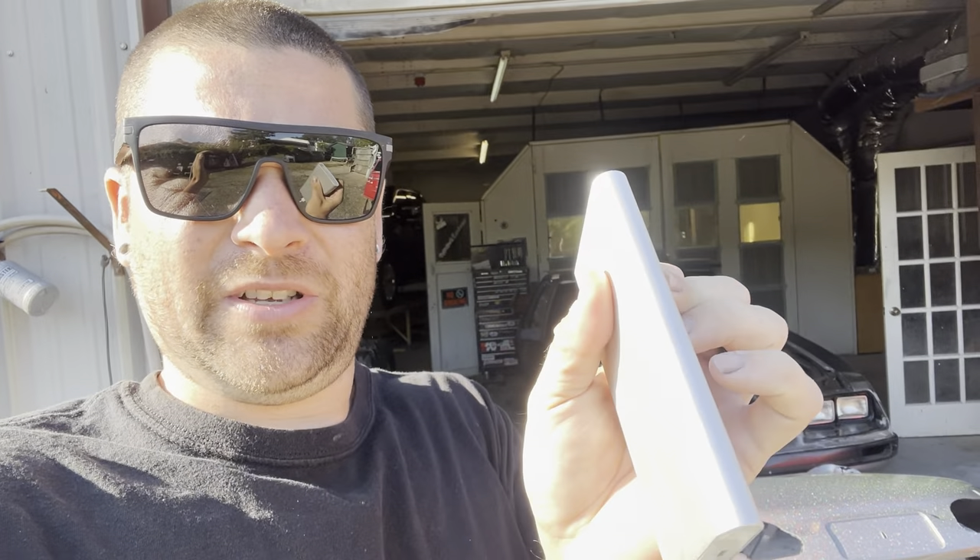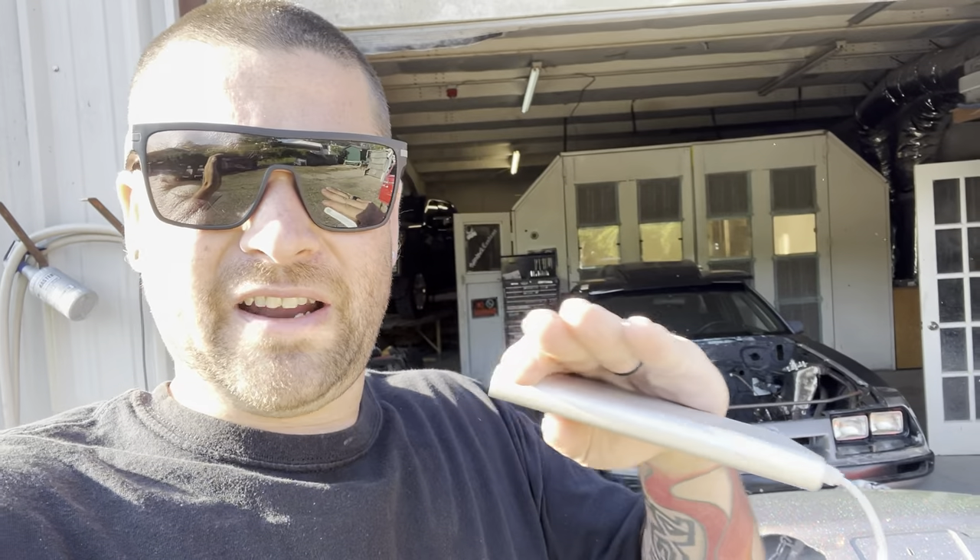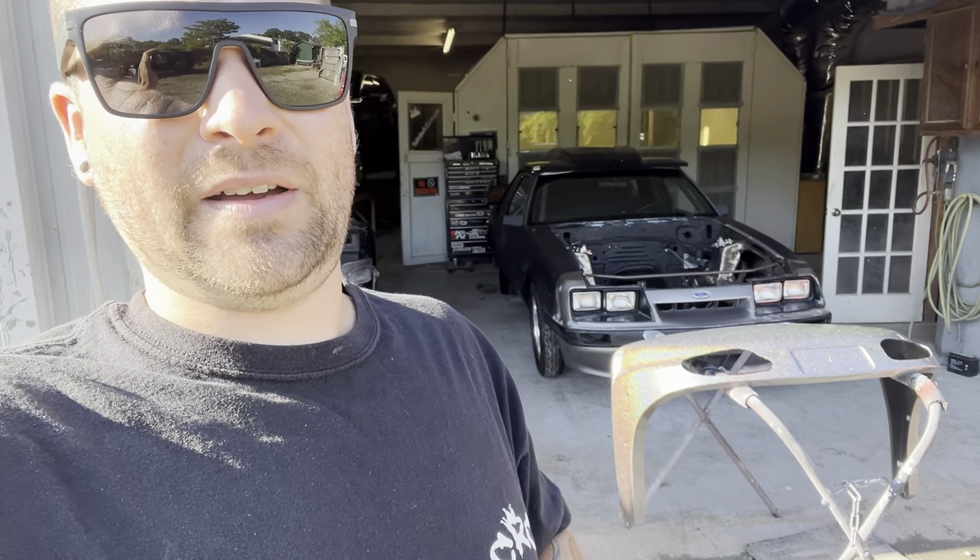It's not trash — what it is, is the metallic standing up in it. Think of it like a square piece of cardboard stuck straight up in sand. That's how a metallic stands up. The clear coat comes up to a certain level but you've got these little tops sticking out over the clear, and we just need to knock those little edges off and then reflow coat it. You can see it hitting in the background — this thing is absolutely nuts.